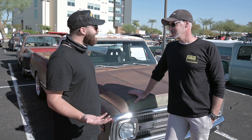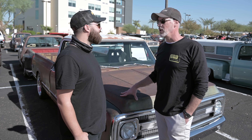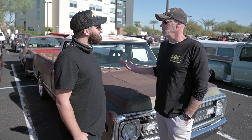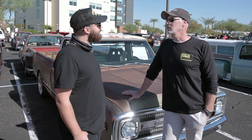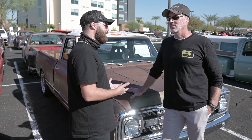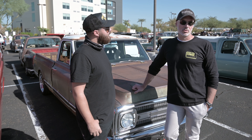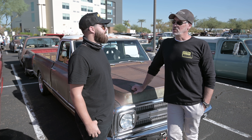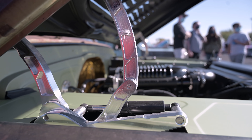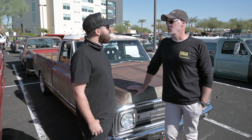What I love about this truck is it's so balanced. I've had 1,000 horsepower cars, but this thing is so tossable. If you want to drive it like a normal car, that's fine — but put your foot a third into it and it's going to wake up real quick. It's a Wegner-built 376 running a 2.9 Whipple, putting down 1,003 horsepower on 93 pump gas — super drivable. We're running a full front-drive setup with a big cooling package. I was driving it this summer in 110-degree Arizona heat and the truck never ran over temperature.